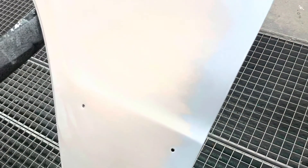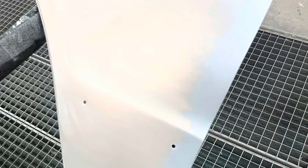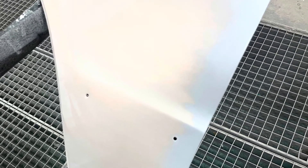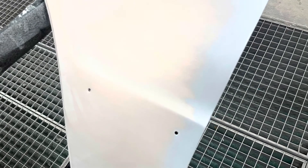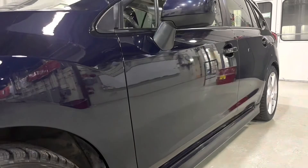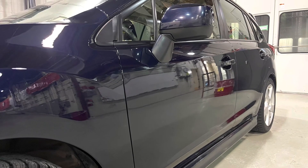Fortunately, most paint manufacturers today have created VOC-compliant products that provide good adhesion and corrosion protection, meeting requirements for vehicle repairs while also being easier to apply than conventional conversion coatings. As you can see from the process, it would be very challenging to use conversion coatings on all bare metal dealt with in a body shop.